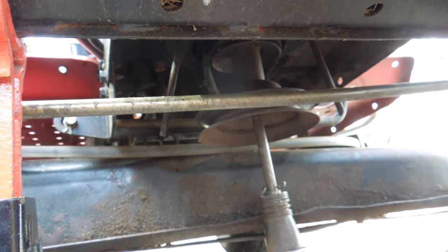That's about it for the front. Make sure your belt is in there properly — it's a bit dark under here, sorry about that. There is a bolt or something there to keep the belt from slipping off, one on each side. Just make sure your belt is on the inside of those and not the outside, and you should be good to go.